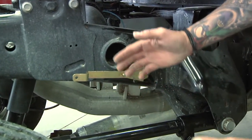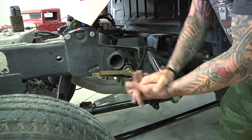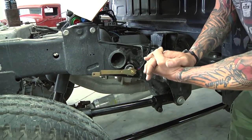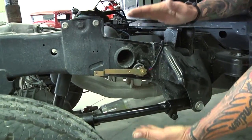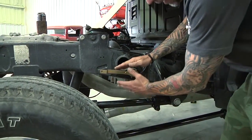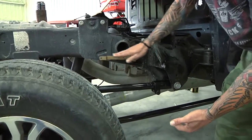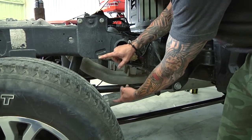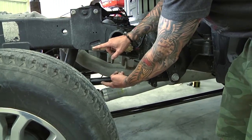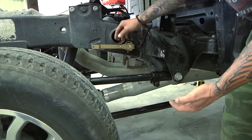The next step will be determining the ride height on this vehicle. With the 5323 airbag, we're going to be in that eight and a half to nine inch range. If it's going to be an 8979, we're going to be in that 12 to 13 inch range. We will jack up the frame, get it at ride height, which puts our trailing arms at the right angles. Then we'll set our bar straight out, cut our linkage to get it straight, so that the bar is straight out — that gives the sensor a neutral reading at ride height.